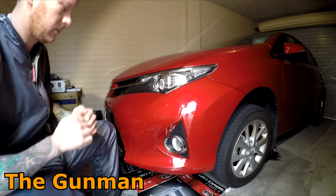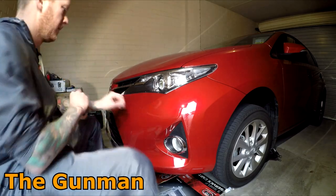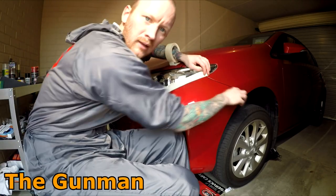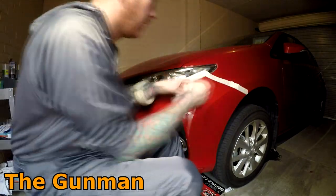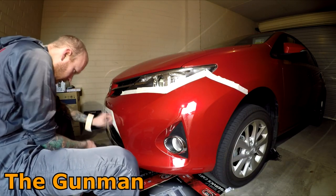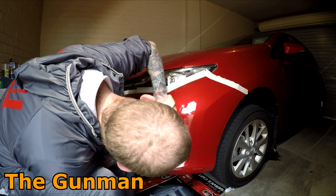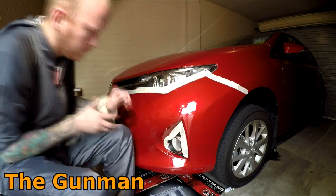As I mentioned in the first video, I'm going to do my best to speed this video up so as not to waste too much of your time, but also still want to include all the information necessary so that in future you guys will be able to carry out similar repairs at home. As I did mention in the previous video, I would highly recommend looking into getting a compressor and using some two-pack paints for this kind of work, because you will possibly run into some issues when using aerosol acrylic spray cans, especially when you go to spray over the top of it later. If you do decide you're not quite happy with it, you can get some reactions with the acrylic paint underneath.